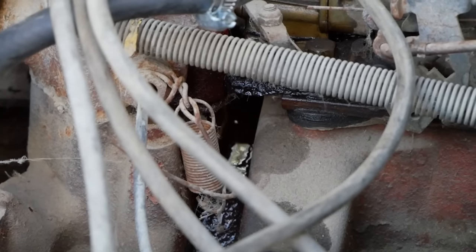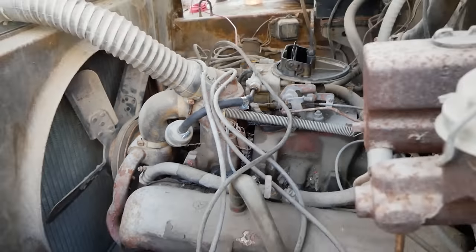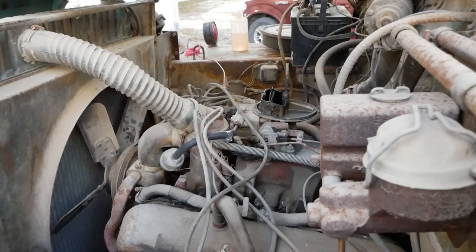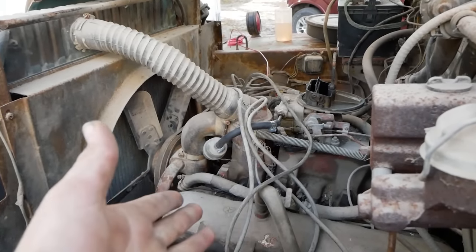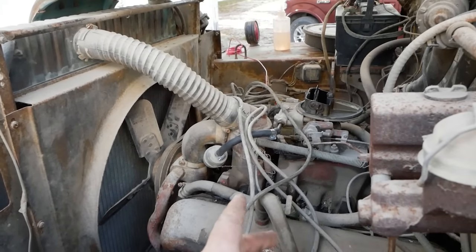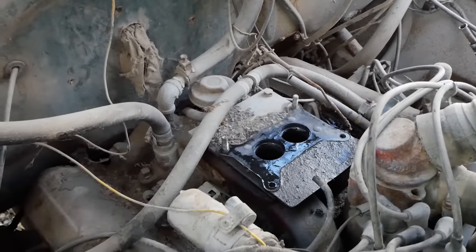That is not at all where I thought the fuel leak was. I thought it was that hose, but it looks to be the front of our carburetor bowl is leaking. Probably, if I had a guess, the accelerator pump. And we talked about that in the last video, that this is exactly what happens. So this is a perfect example of that. I guess at this point, I need to go get us a carb kit. That is ready to come off, as you can tell.